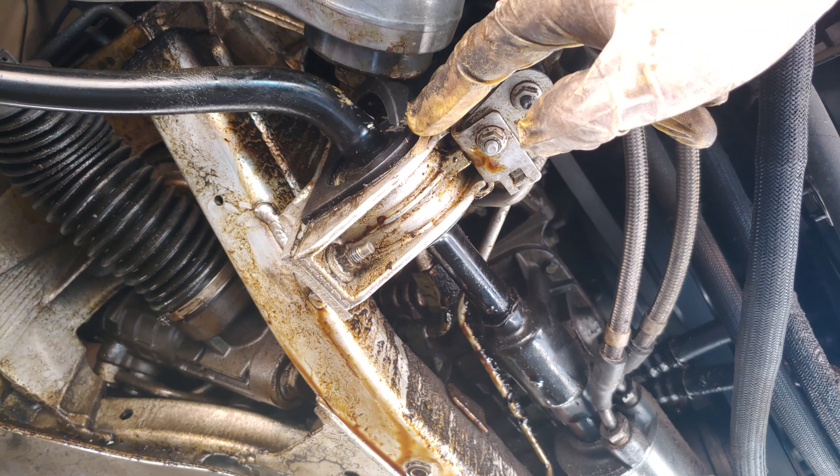The next thing is to slide this in and clip it — there are little clips here. Right at the end there's a size 8 screw, one on each side. Once those are in, you can tap in the press pins. The way you push them in is to make sure the washer part is flat and then tap in the head. You can screw them in but I just tap them. Then right along the seam here you've got to seat it — it will clip in all the way along.